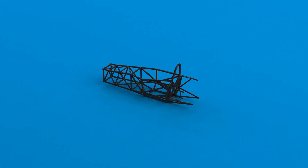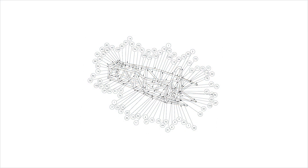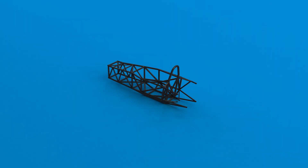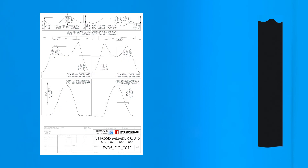Part of the design process was figuring out how I would actually build the chassis. A drawing showing every single tube in the car was produced, which would be useful after I had cut the tubes and needed to know where each one went. A round tube can be difficult to build a frame from, as you need to cut the ends of each tube to accommodate the attaching sections. Solidworks was invaluable here — I was able to unwrap and flatten the round tubes, then put markings on drawings which would be printed on sticky paper and used to cut the tubes.